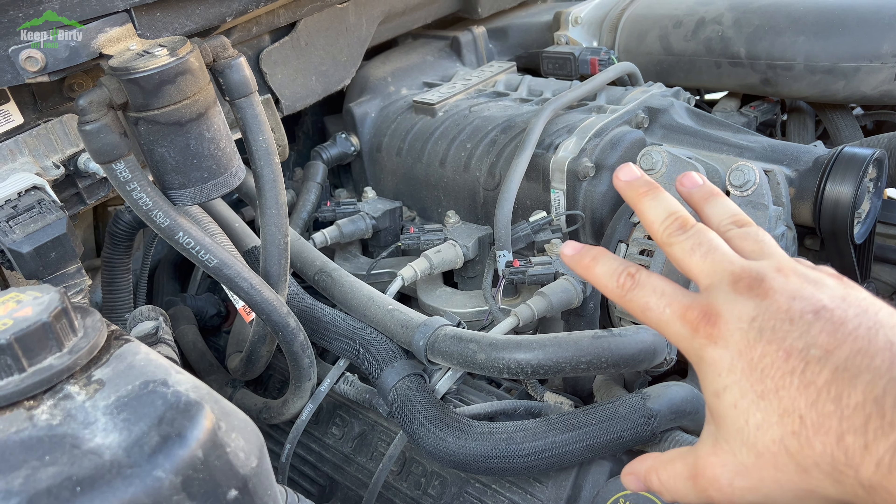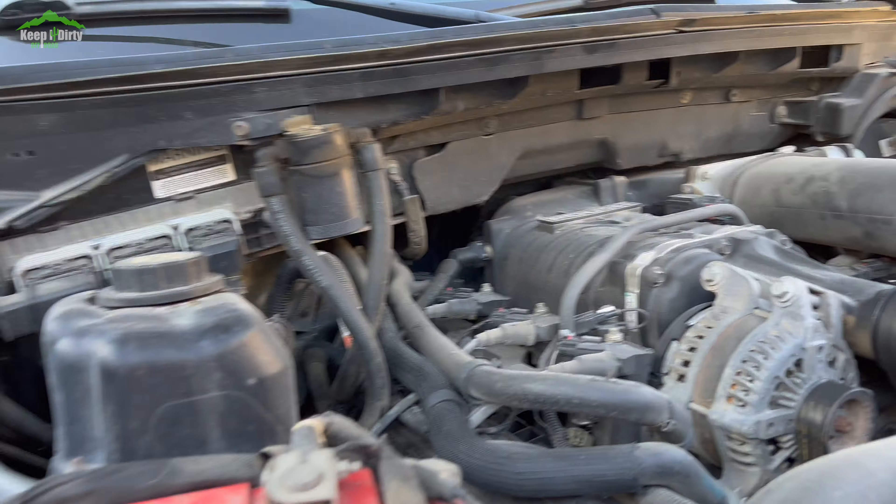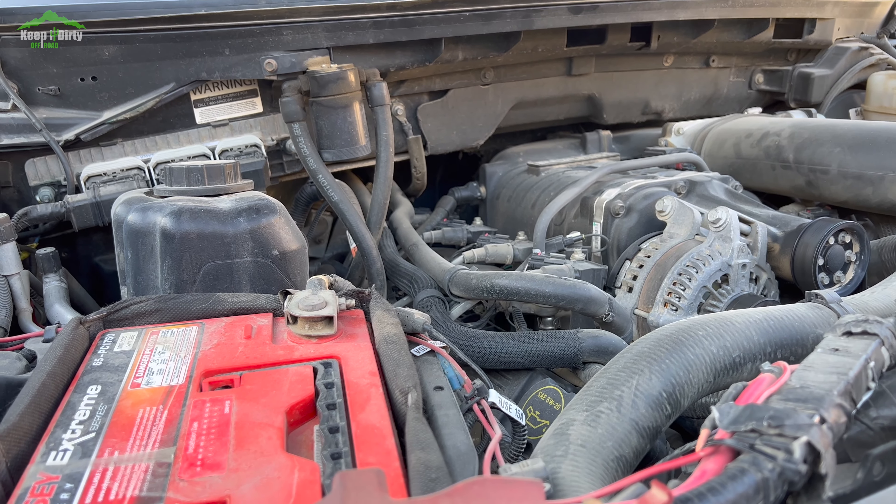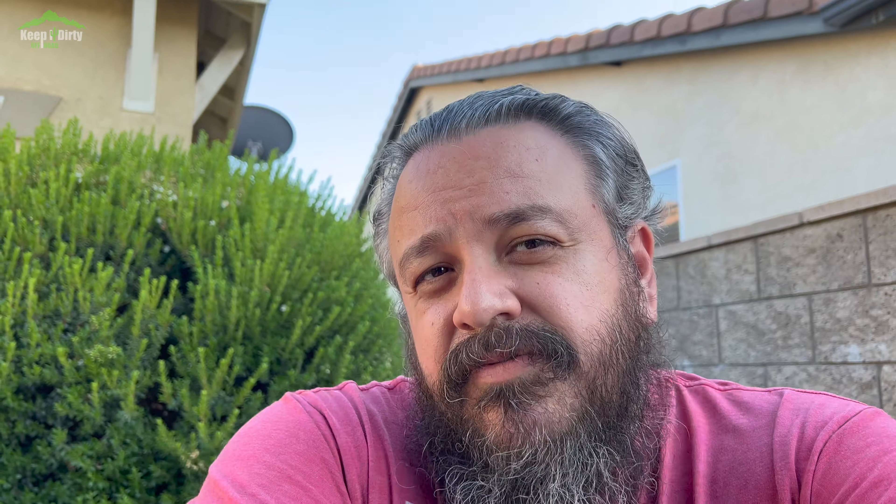As far as what's causing it, it could be one of two things: it can either be the relay that is used to turn on the pump, or the circuit that's being tapped. From an electrical standpoint, this pump is wired to a relay, and then that relay is wired to a capacitor circuit. That radio capacitor circuit is at the top of the engine. A lot of you guys may know it — this is what keeps the sound system from buzzing. Ford trucks have a capacitor built into the engine so that buzzing noise doesn't ever make it into the speakers.